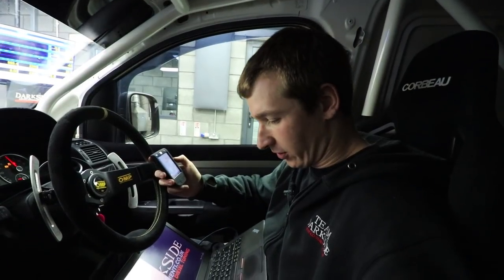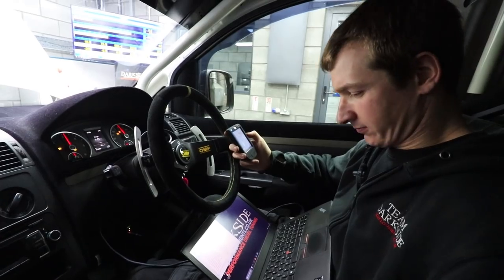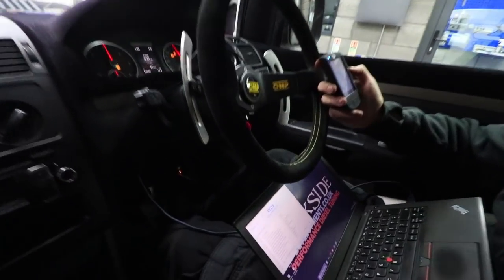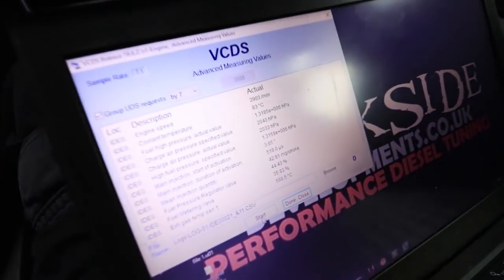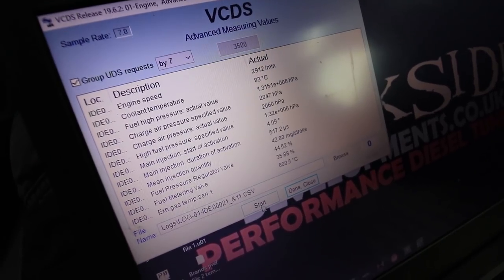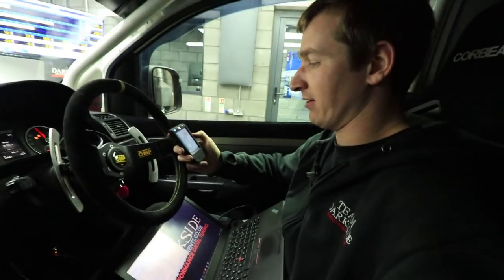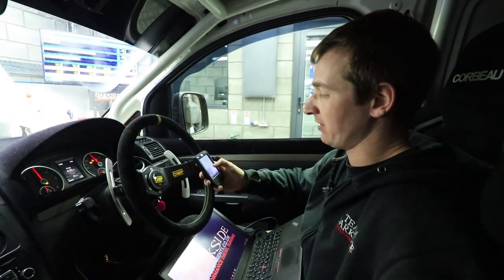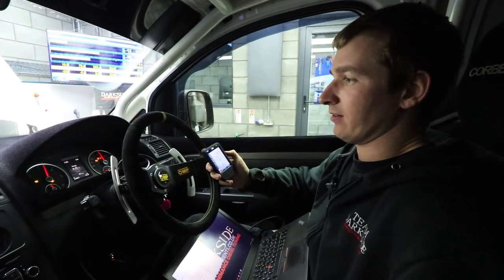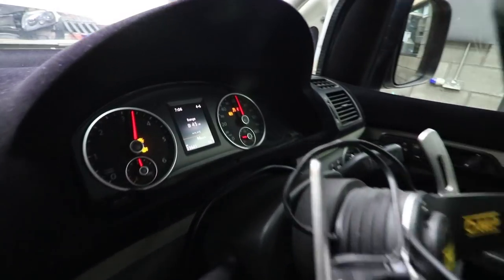So let's go a bit harder up throttle. So EGTs are just creeping, we're probably going to end up at 600 and then I'll back off a little bit. Look at that, good guess. I'll back off just a tiny bit. Like I said, speed's not decreased. I'll go up to 50 mile an hour. I can hear the turbos really spooling there.